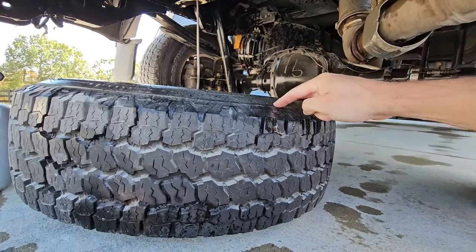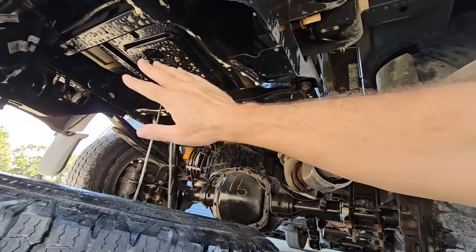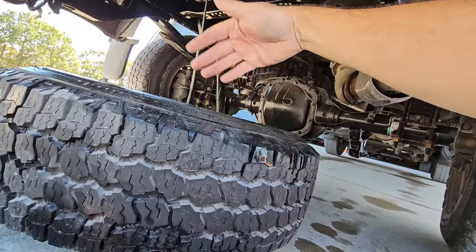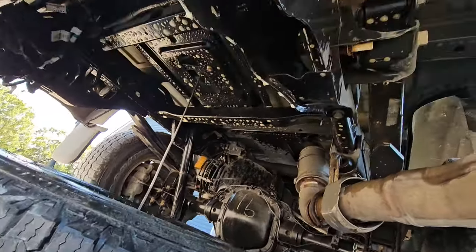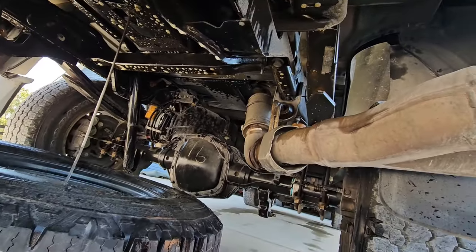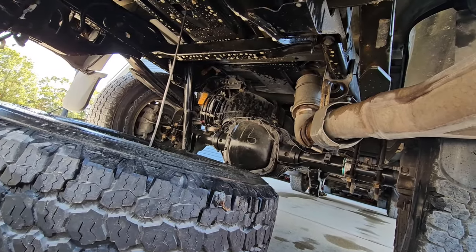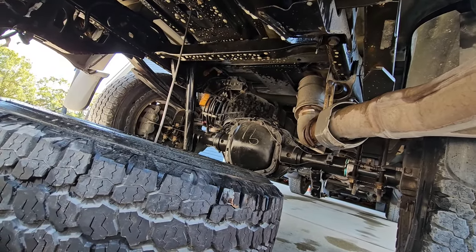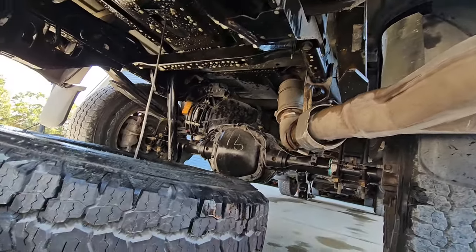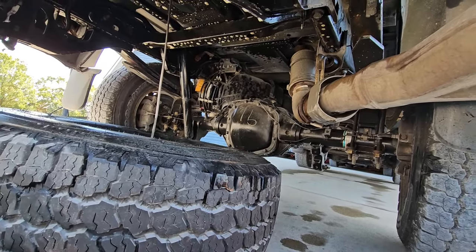So it's pretty important to go ahead and lower your spare tire because road salt and junk will get caught up in here pretty commonly, and it gives you an opportunity to clean out your spare wheel also. You can see that I've covered all this with the cleaner, letting it soak for just a minute. And now it's time to go through and pressure wash all this out and rinse it really well. Then I'll let it air dry and we'll come in here and undercoat it really good with that aerosol spray, and I'll kind of show you how that stuff goes on.